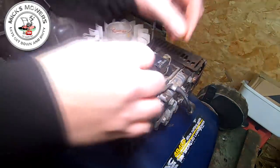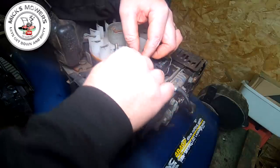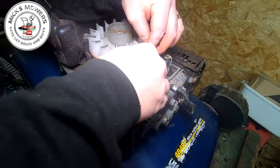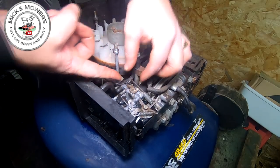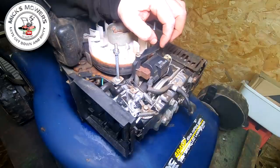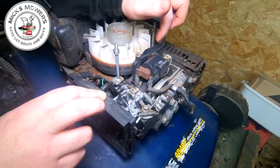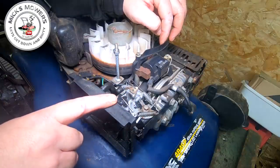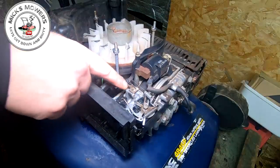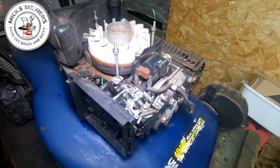I think I found one — I think it was in the bits and bobs box. I might have to take the whole carburettor off to do so to get it all on. There it goes. I'll just get that to tweak in there a bit better — there it goes. I might just have to bend that up a touch. Now that does seem to be working, but it wants to be cool just a touch more. But now you can see what I'm on about — you get this reaction now to this machine. As it opens up at full revs, you can then idle it back down with this control here. You'll now see it all move — less tension on there which is idle, more tension and it opens it up. Hopefully that will fix it.